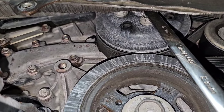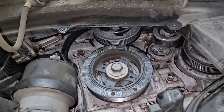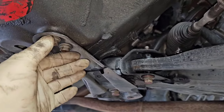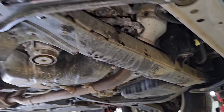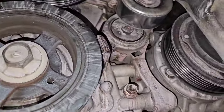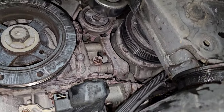I can't film this and break these free at the same time, let me get this done. As I suspected, there is not enough room to get this out, so we are going to have to lower the cradle. What I'll do is lower the cradle on this side, take these brackets off from this end leaving the other end on, then loosen the center bolt to start letting this side of the cradle down. I'll have safety jacks underneath. We also wanted to change the tensioner, and the tensioner is actually part of the AC compressor mounting setup.